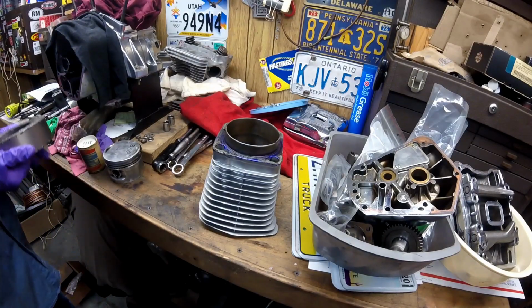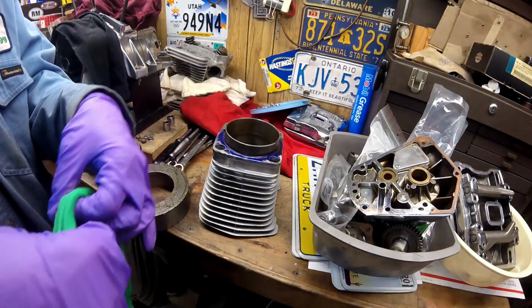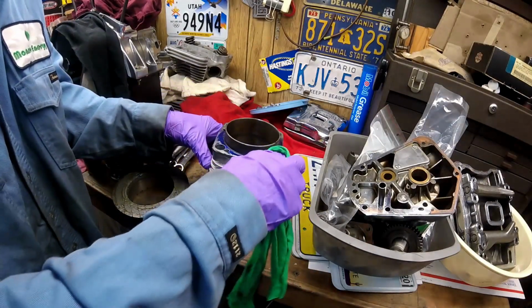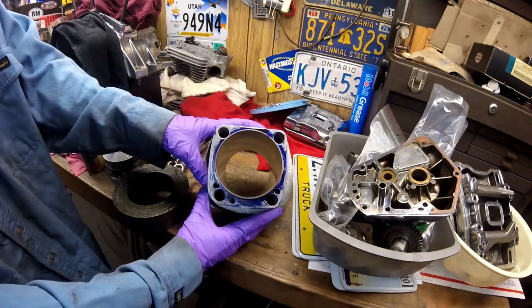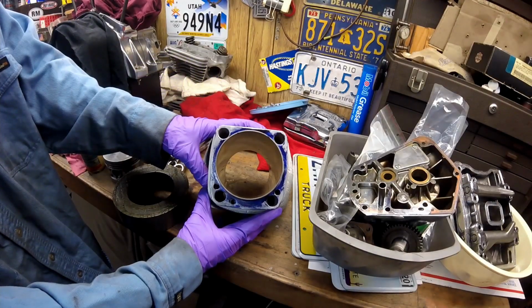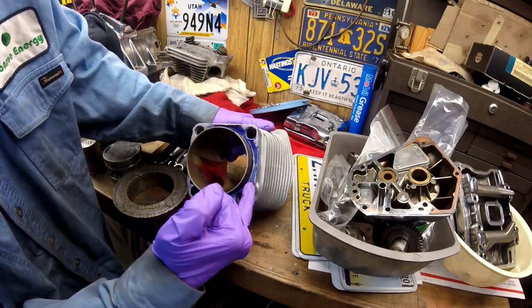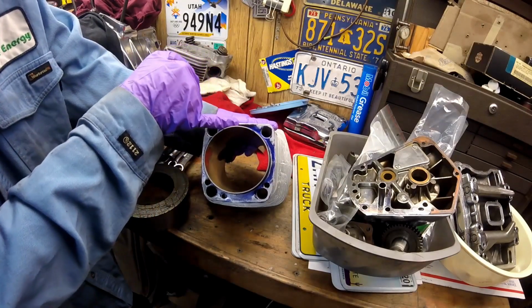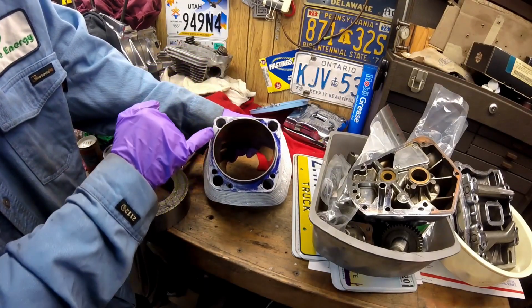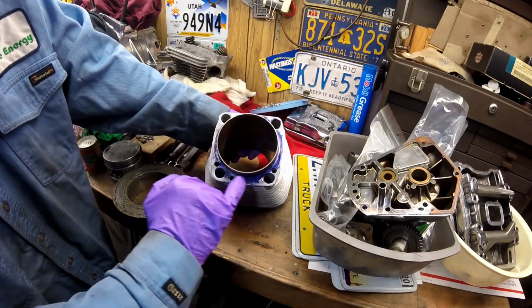Now when we take off the lapping compound, we'll be able to see the high spots and low spots. We'll be able to see the damage that the person did when they took the grinder to this. The Trock Block will take out small imperfections, but as you can see with this, somebody ground in here real deep because it's not even touching it. In here real deep. Here it's not touching at all.